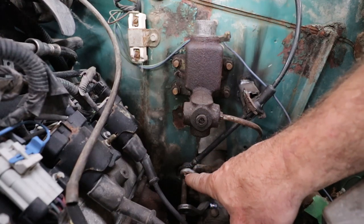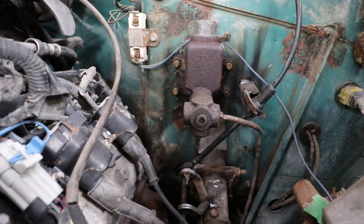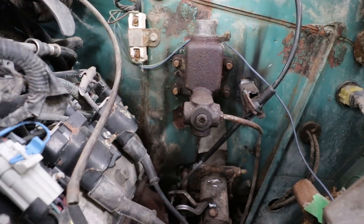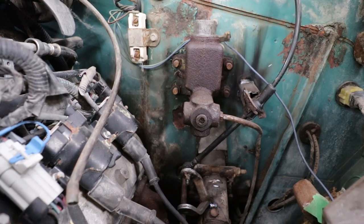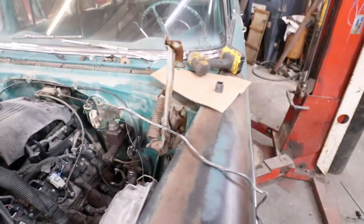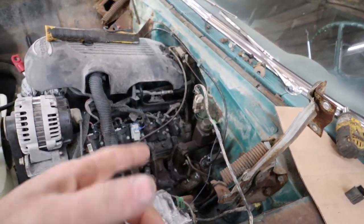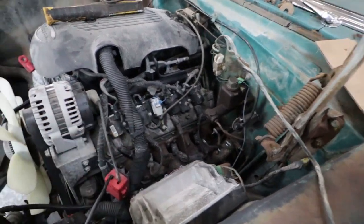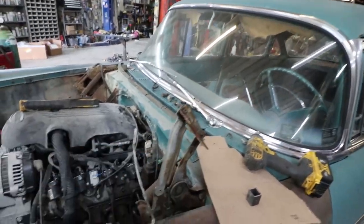Like I say, I just took the pin off and welded it in there. I just put the tab up there. And now when you're in the car, come on, you've got full sweep. Easy peasy. Because I'm going to be using the plug everything on here and I still have the neutral select, you'll have your neutral and your park safety. So that'll be good. But there's no lockout, so a guy's got to be kind of careful with the shifter when doing this kind of a setup.